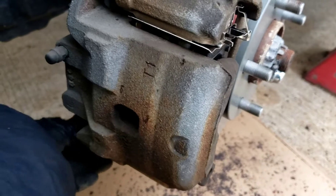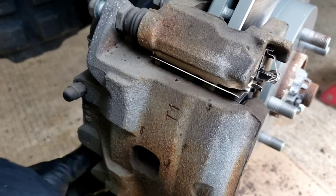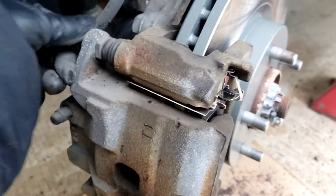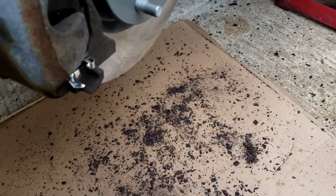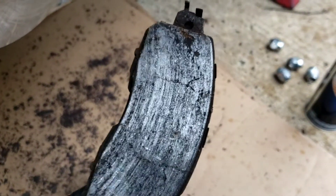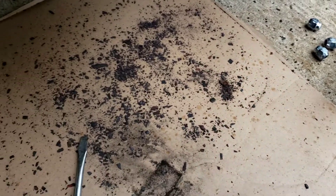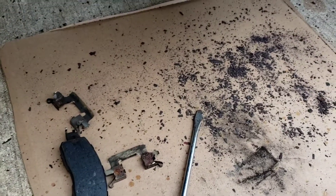It's all about attention to detail, people. Make everything clean, wire brush everything. Don't put any grease on the pads or the rotors, otherwise it'll give it a reason to squeak. Now look at the old pads — it has heat stress, heat cracks. That'll give you noise. Pads are down; they start to crack when it gets really thin. Change the hardware, people — don't forget, very important.